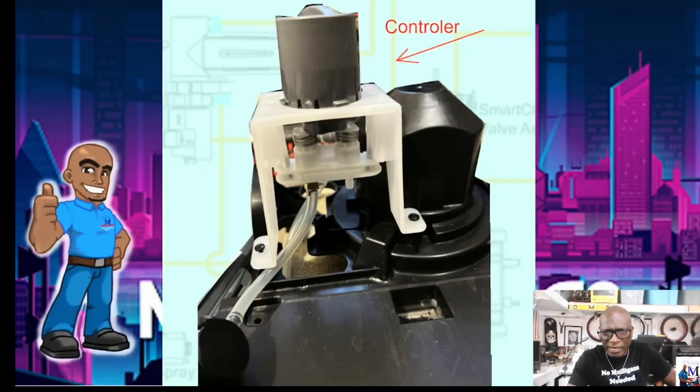It seems a little complicated for these units, but all the units are really doing the same thing. The motor is assisting the pump in extracting the water from the tank and from the solution. Some machines have the tank and solution built into one — just one connector pulling it down. Some want them separate, and in this particular case it's separate. If you have questions, feel free to ask. I'm really doing my best to explain it properly. I'm thankful for your support. If you haven't done so already, please hit the notification bell so when we put up a new video you get notified right away. Please subscribe to the channel and share this video if you can help someone.